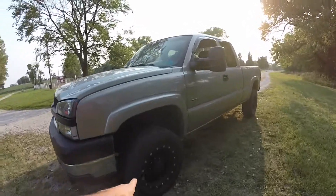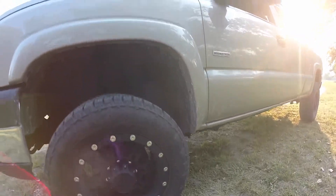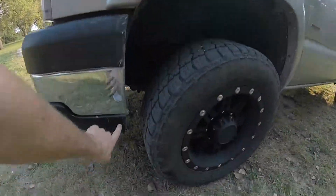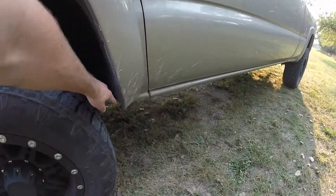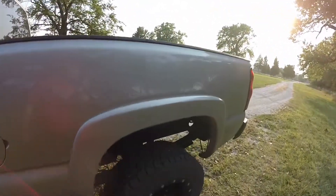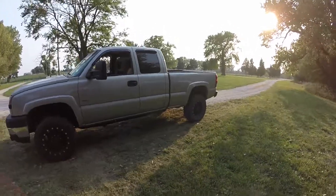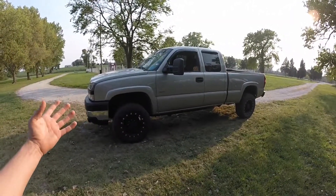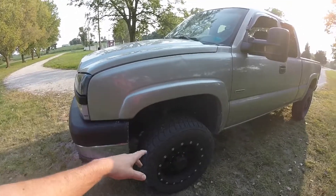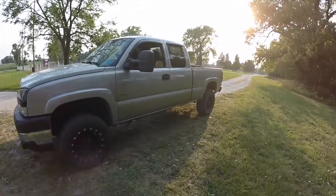So that's what it's sitting on. These tires are a 285/60, which translates to about a 31-inch tire. The previous owner even had to cut a little bit, and when you turn you get pretty close to contacting. The back is just fine with the blocks from the leveling kit. It's basically a 31-inch tire on an 18-inch wheel, about 9 inches wide, and that alone creates a little bit of trouble.